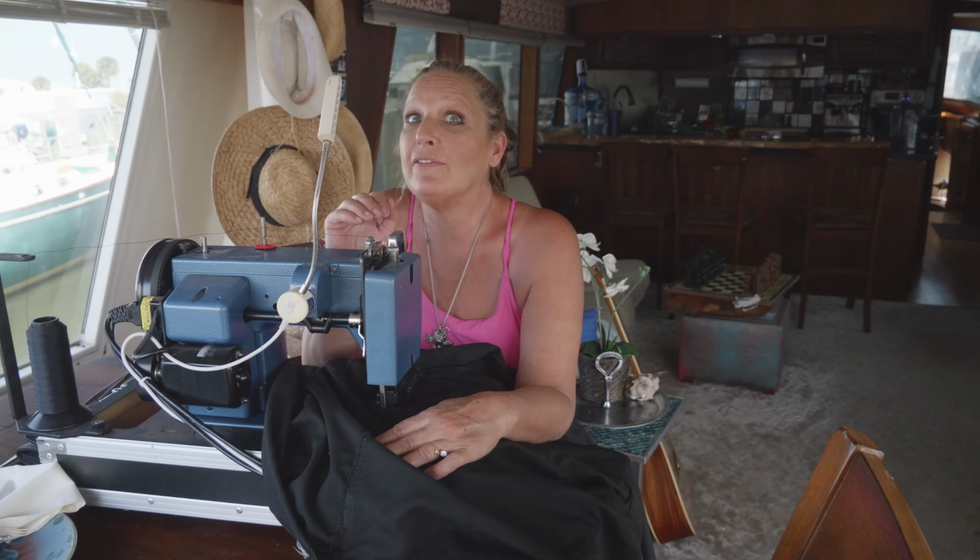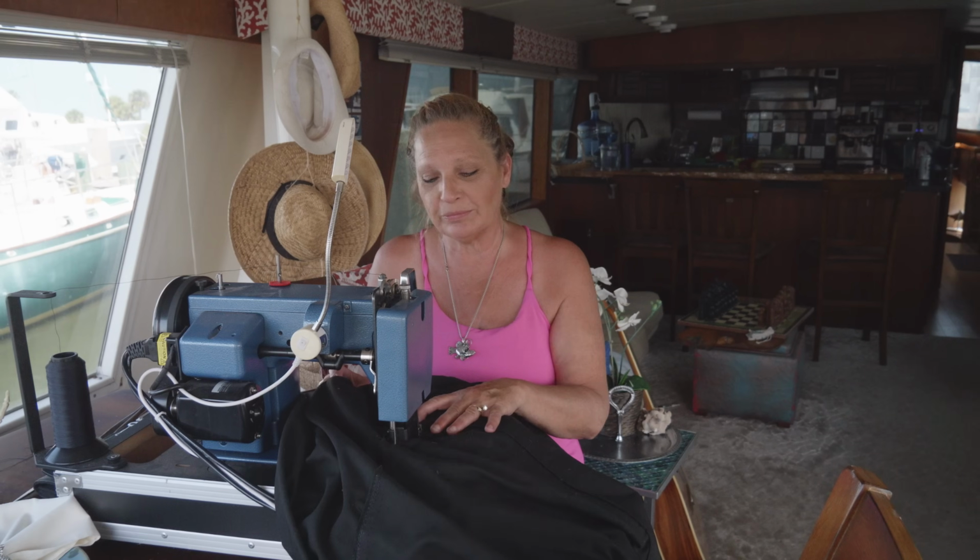I am so glad we have this sailrite sewing machine on the boat. We had threads on the canvas that failed. The canvas fabric itself is really good. It's just that the threads failed, so the zippers started coming off. And the dinghy cover is split, but luckily it's split along a seam where I just had to sew that up. Again, the threads failed. And the cushions upstairs started to split. The thread, once again, that hits the sun all the time, also started to fail. So I just zippy-doo-dahed them up, and they're as good as gold.